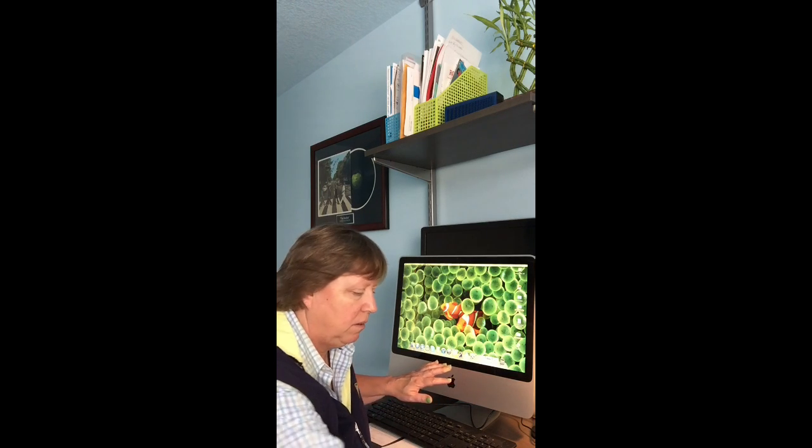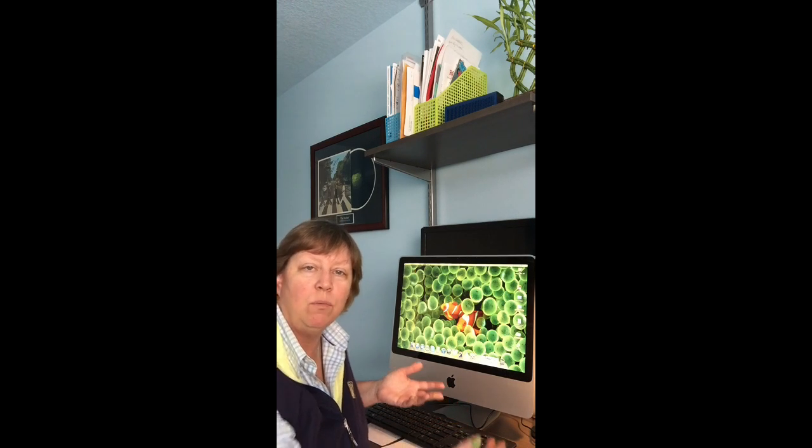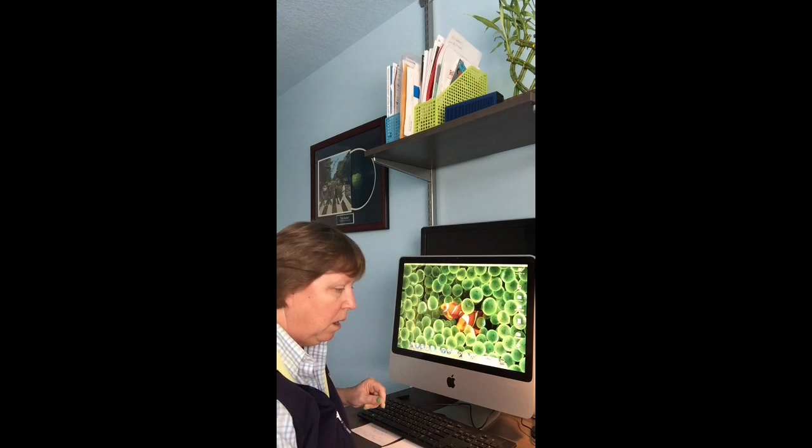And once we were done with that, we were ready to upgrade to OSX 10.10. But there's a specific path that you have to use if you're currently on 10.5, which is what this computer was on. So the path that we had to use was we first had to get ourselves a copy of OSX 10.6, which is Snow Leopard. You can't go from 10.5 to 10.10 directly. You have to go to Snow Leopard first.